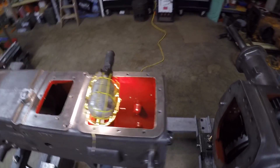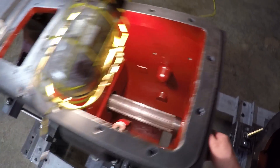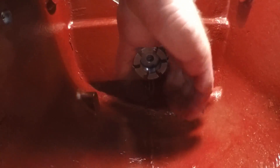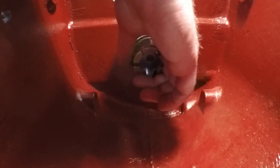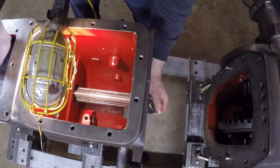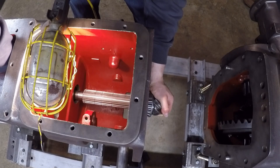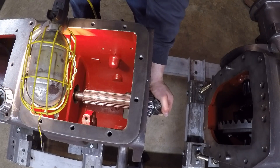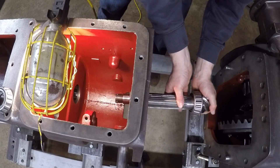So to get those gears on that shaft, I first need to get that taken back out of this housing. I did have some preload on these bearings so this nut was cinched down a bit. I just need to get it taken off, disengage it from that front bearing, and get it the rest of the way out of the housing.